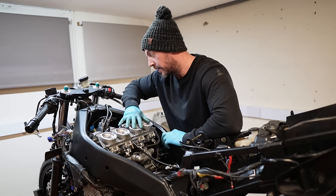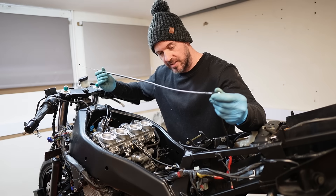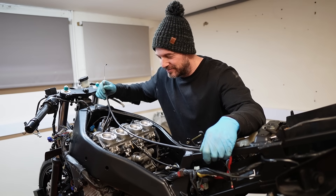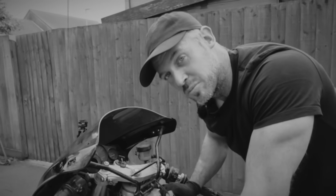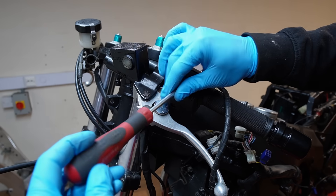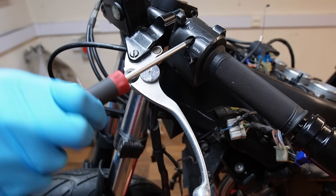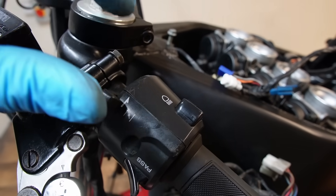This is quite an old bike and what old bikes tend to come with is a choke. This is the choke cable. This isn't the first time this choke cable has caught me out - when the engine was being removed I missed it then too. Slight issue: we have the choke on this bike and that cable is still attached. Come to think of it, I actually do know where it goes - it attaches here and then hooks on that lever there. So I'll whip off the left handlebar switch gear to attach one end of the cable to the choke lever, then attach the other end. And look at that - a functioning choke.